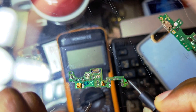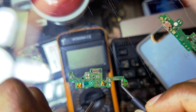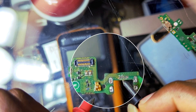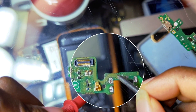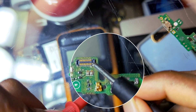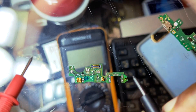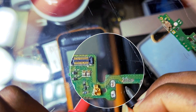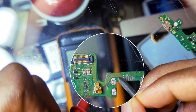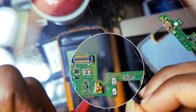So we have the DM, DP, and VBUS, which are the most important and are not that easy to track. Even though they are quite easy on some PCBs — like this PCB right here. If you look on this PCB you will see that we have a bigger track which leaves the charging port position right here and goes right to the connector flex. The easiest way to jumper the charging port is to look carefully: where the VBUS peeled off, is there a bigger track from the point that peeled off?